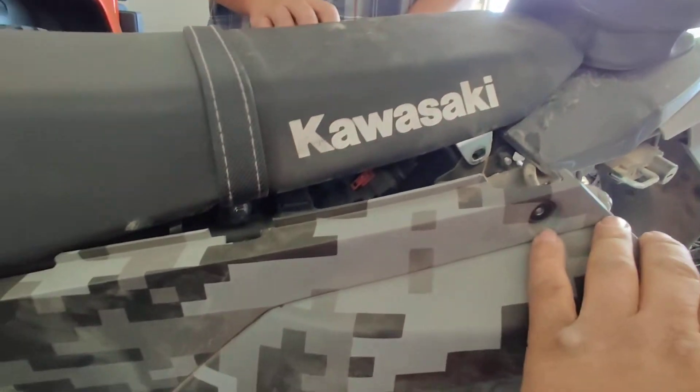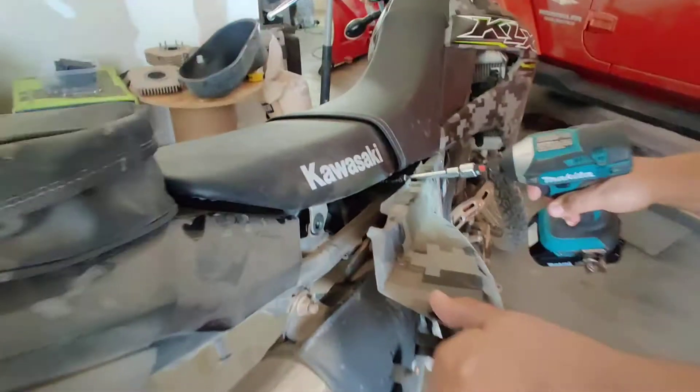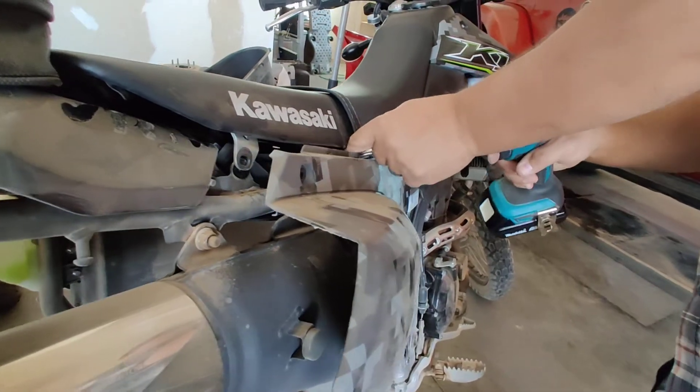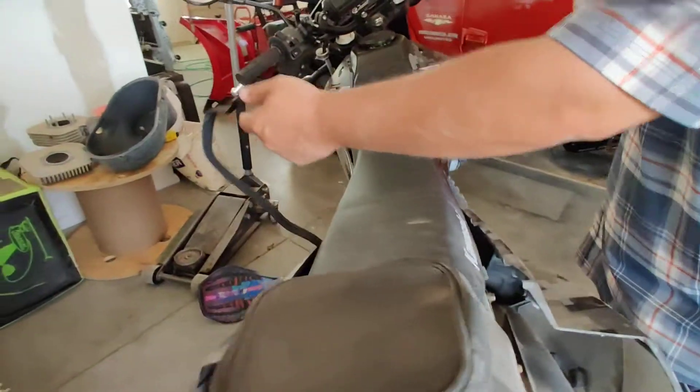The seat still ain't gonna come off. So just kind of pull this side panel back right here and there's another bolt right down in here — same on this side. It's basically just strapped right to the frame. Boom, look at that — one side done.